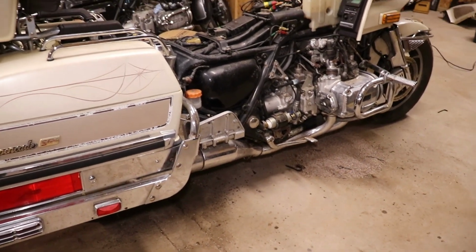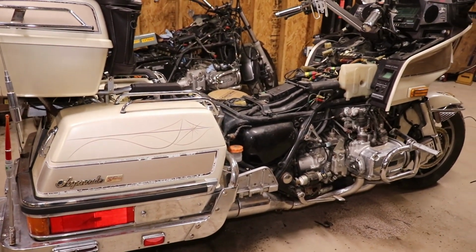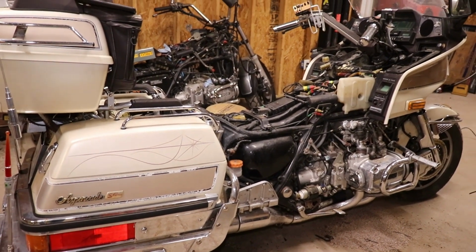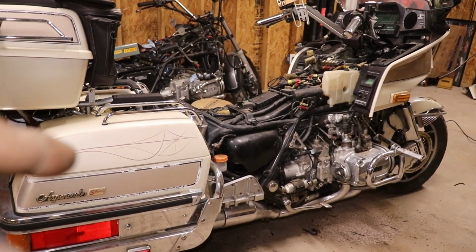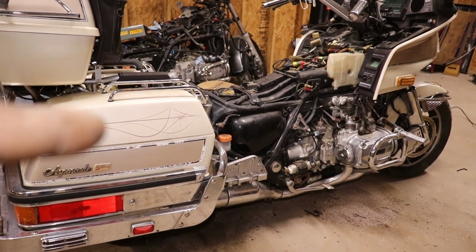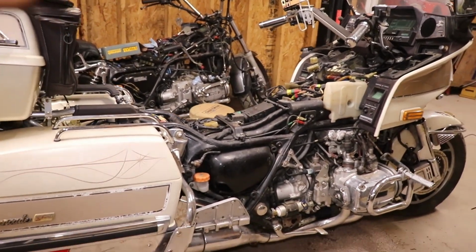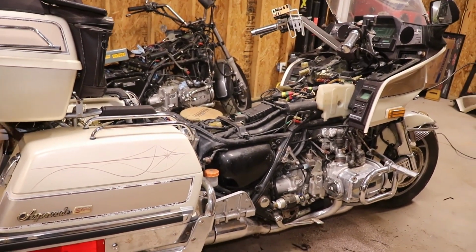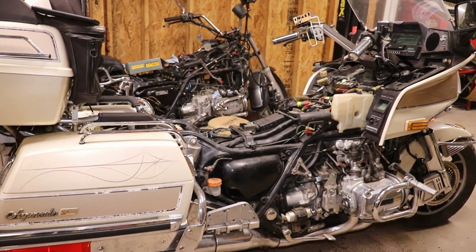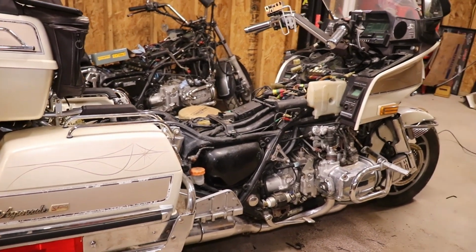But I'm gonna keep tinkering around with it, and like I say, get the clutch working. Hopefully it's just the master cylinder, not the slave cylinder. If it is, it's gonna be a job to change out. I just had to take it off the parts bike. But I know the master cylinder, the little eyeglass is broken on it, where you can see your level for the brake fluid. So it's no good. I think the piston's stuck in it.